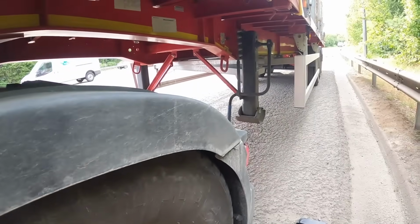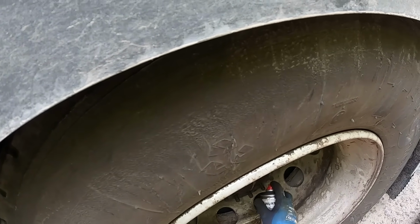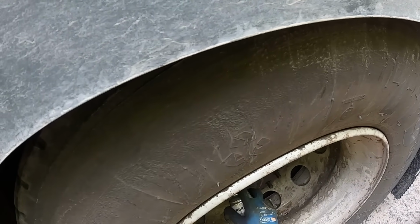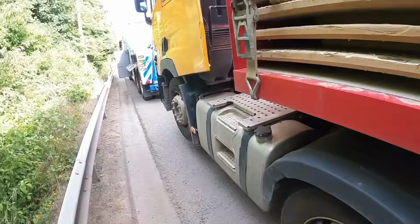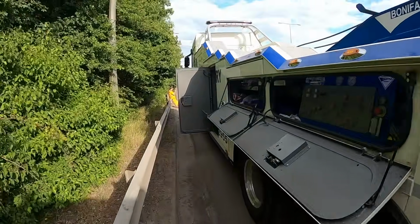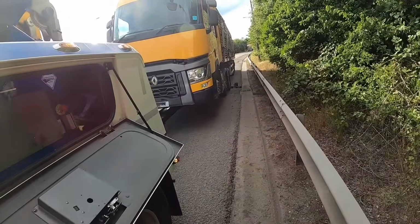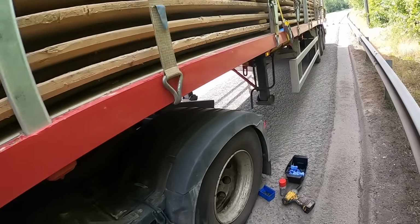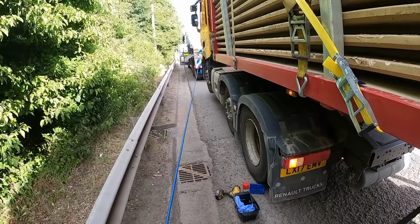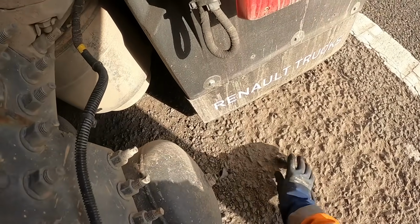It's quite a busy rush hour down here. Plenty of squirt. It can be soaking in, and I'll probably get an air lead out next. So we're going to put 3 airlines out, 2 into the trailer and 1 into the tractor unit. Under these I actually have got a test point under the wheel arch, but I don't tend to be too successful getting air in there. But they've got an air tank at the back with a nice test point, same as a Volvo's actually, so I tend to use this to blow into.